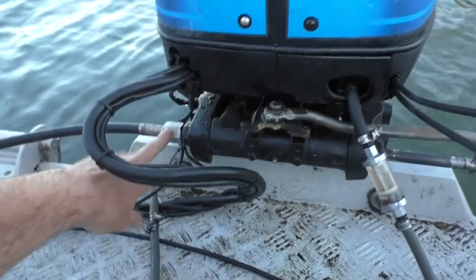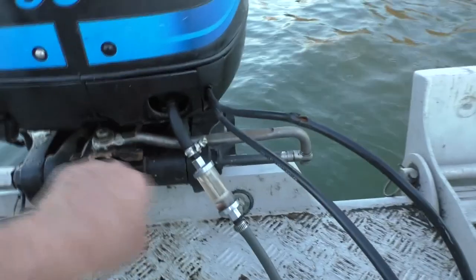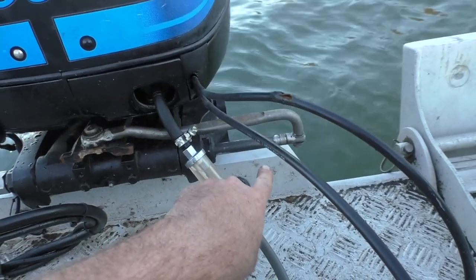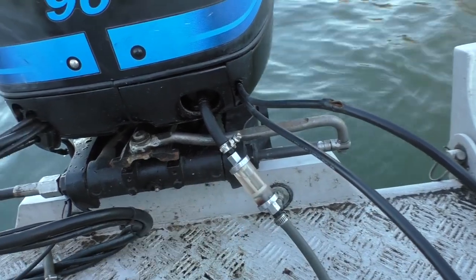This is the standard cable steering — a single cable comes into a drag link and it's a spiral that goes into the helm. You wind it and it just moves the drag link backwards and forwards. There are a couple of disadvantages to this sort of push-pull cable steering. They're a little bit prone to corrosion, and they can take a fair bit of strength from the driver's point of view to turn a large motor like this 90 two-stroke.